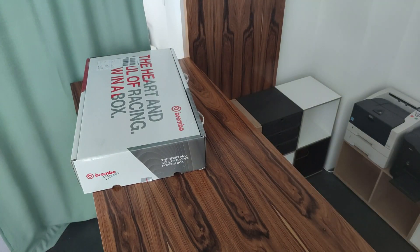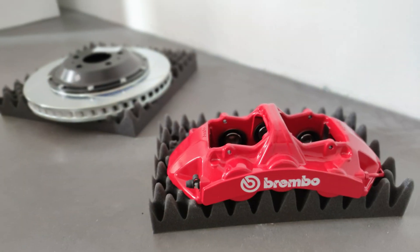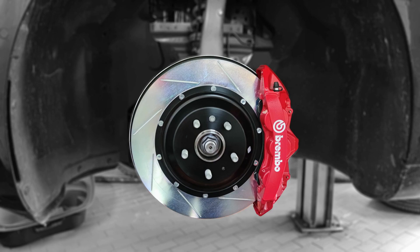That was the unboxing. Of course it goes for left and right, so during installation you must ensure the left and right sides are mounted correctly so the cooling functions properly. I have now driven approximately 800 kilometers with the brake system including the bedding-in process, and you simply notice that after multiple braking events the brake remains very stable. The deceleration was at most 11.07 or 11.1 meters per second squared. We did a full stop from 160 km/h with no problems whatsoever.